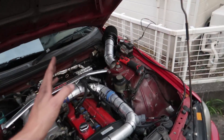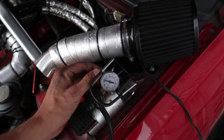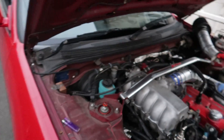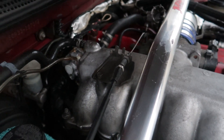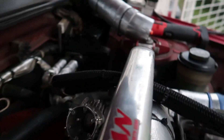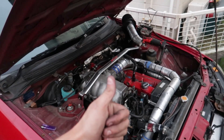I've got the compressor on — building up pressure and we'll start spraying and check for leaks. We're already at about 5 psi so we can start spraying and checking the previous problem spots. Looking good to me — nothing there, nothing there. And the blow-off valve, which I'm pretty confident will have no problems at all — nothing at all. Vacuum leaks solved! I'm going to wait until it gets to 10 psi and go again, but that looks very promising.